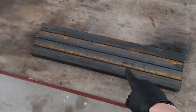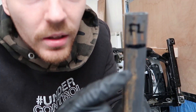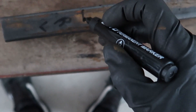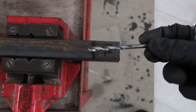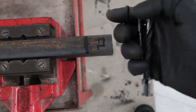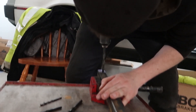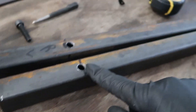Right, so I've chopped all of these now. They're all 50 centimeters long. Now I'm going to mark them up on the chair and drill the holes where they're going to go to the chassis first. I've marked front left and roughly where the bolts need to go. I'm going to go through with the smaller drill bit and then slowly work my way up in sizes — up to M8. Cutting these holes is taking forever because I haven't got a pillar drill, just using two normal drills at different sizes. This steel is quite thick — 2.5 mil — so it's taking forever.